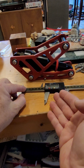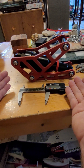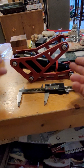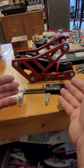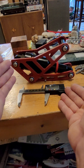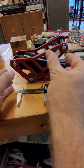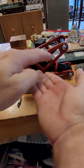So what are the alternatives? There's a popular solution being talked about — under $100 — where the shock is replaced with a coil shock with a high load rating that greatly smooths out the ride experience of the Master. However, that's really putting a band-aid on it. You'd still only have 21 millimeters of shock travel to 70 millimeters of wheel travel.